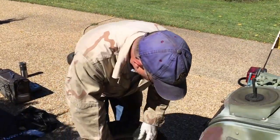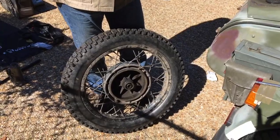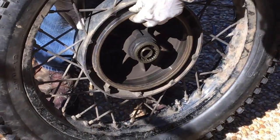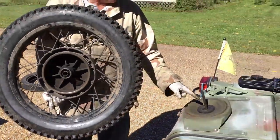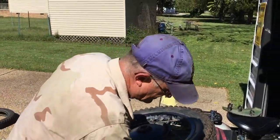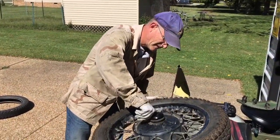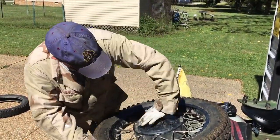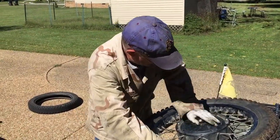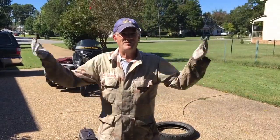One quick thing I want to mention for newbies especially: if you have a spare, grease it. You don't want to be out in the middle of nowhere swapping your tire and not have any grease on the splines. Just pre-grease it — it'll collect on the rim tube area but who cares. Make sure the cap is tight, put the top back on, rotate the whole thing — and boom, he's not going anywhere. That is the end.